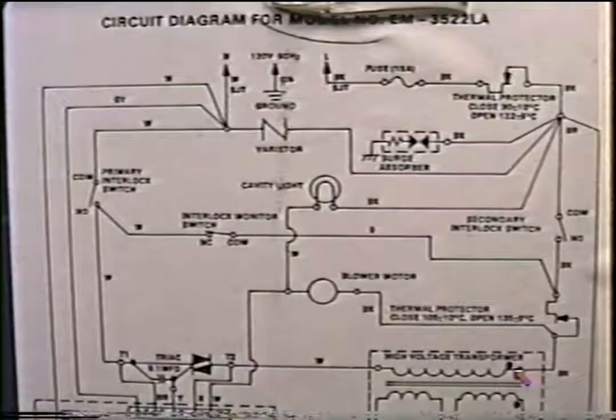Again, use alligator clips and then stick one end of each lead right there. Okay, there is another way to do it that may be a little bit quicker, and some might prefer the amp probe meter. If you just stick your amp probe meter around one of these wires, you should be able to tell if you're getting power to the windings or not. I'll explain a little bit about that later. But right now, let's just work with the voltmeter.